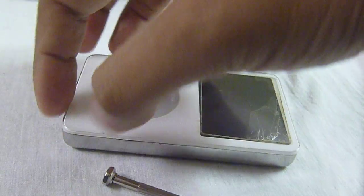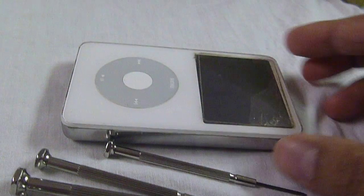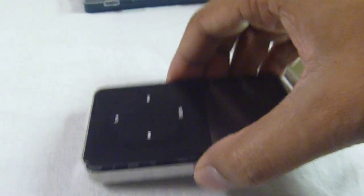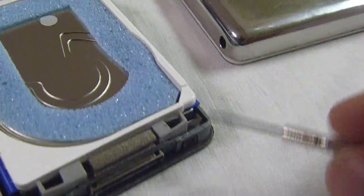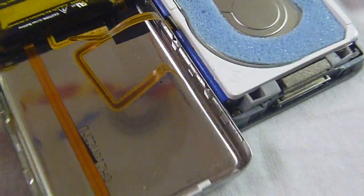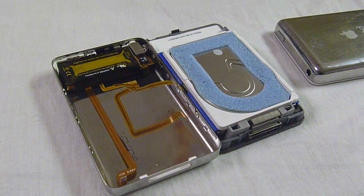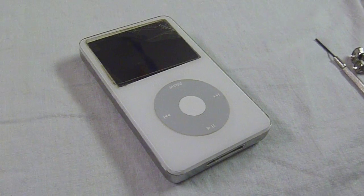Once you get a tool in, finagle it out carefully so the device doesn't slip off the table. Then finesse the jeweler's screwdrivers along one side — you don't have to go around the entire perimeter, just work the right side and you should get it open. When it opens, don't yank it up immediately — just open it a tiny bit. There's a header in the corner where the battery cable is connected, so crack it open gently and pop that open. There's also a ribbon cable for the earphone jack, so be very gentle. At that point you can do maintenance, upgrades, whatever the case may be. That's all I have — thanks for watching.